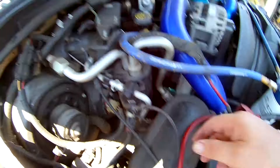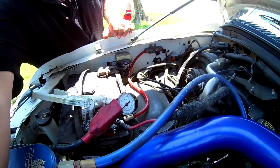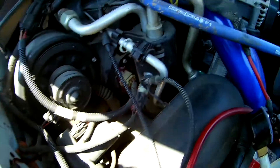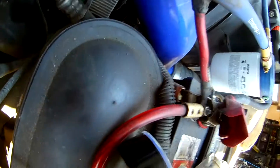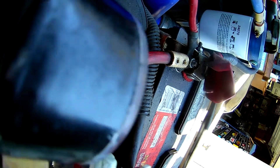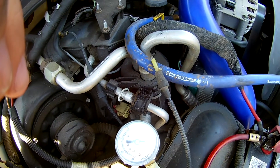I just want to show you a couple of procedures on how to check this. Here, this is a Power Stroke 6.0L 2006. This is the actual vacuum pump right here — it's down on the passenger side of the engine compartment. There are some vacuum hoses going from that, and I have my little hand vacuum pump here which actually creates a vacuum. I'm looking for a leak and I think it's somewhere here.